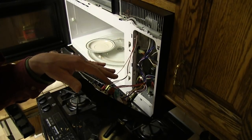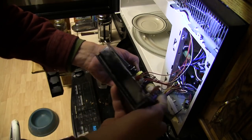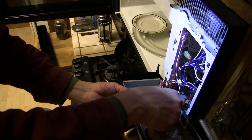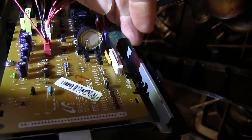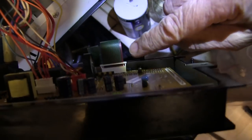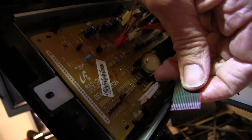Step four is to remove and clean all the wires plugged into the display panel that now hangs in front of the unit. There are a half dozen wires that must be removed, cleaned, and then put back into proper place. It's probably wise to take a few seconds to study all the connectors before you remove them and to use an indelible pen to mark any cables and connectors that you feel you might get switched during reassembly. I started by removing the ribbon cable — to remove it, you pull up on the release lock near the circuit board before pulling out the ribbon cable. Take note of the red stripe, which differentiates the left from the right side of the cable, and make sure you put it back where it came from. I don't see any other connectors that can be put back the wrong way, but check carefully and mark any you're unsure of.